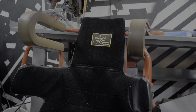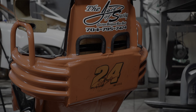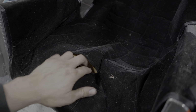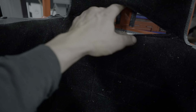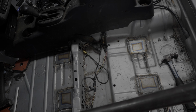A very important part of building a roll cage is mounting of the seat. First of all, you need a purpose-built race seat, and it cannot be one of those crappy plastic bucket seats. It needs to have strong mounts. It can be on sliders, but the seat shouldn't wiggle. The seat also needs to have a hole for your crotch belt, 2 for the hips, and 2 for the shoulders. I solidly mount my seats to the floor with spreader plates equivalent to the roll cage.